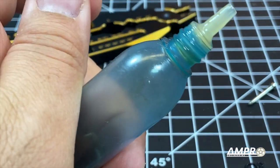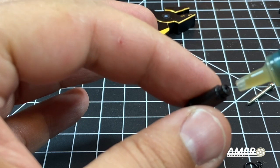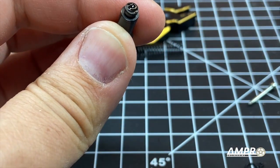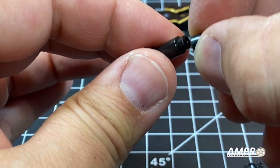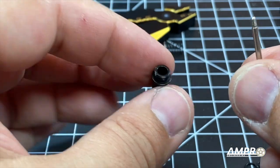Okay, so you have two of those. Push them in the top like that, okay? So before you put the cap back on, take a little bit of oil. This is some 15 weight, and just push it like that. You want the O-rings slippery. If they are not, when you put the shock shaft through, it's possible you could tear them.